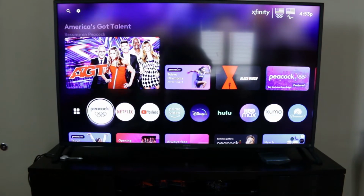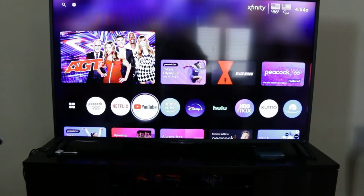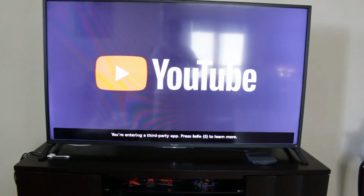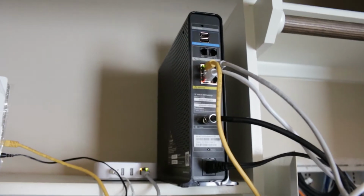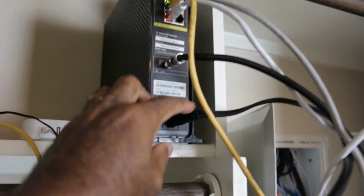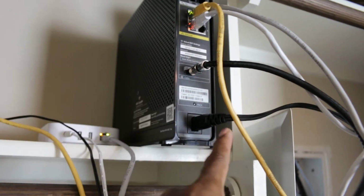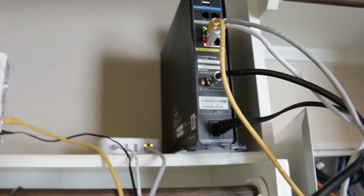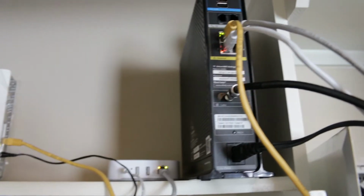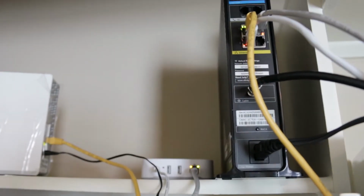First, I have to check whether it is a router issue. In my case, I know that my router is okay because other devices connected to it function well. When you have a router issue, you can simply reboot the router by unplugging the unit and replugging it from the electrical supply. Most of the time, this resolves the problem. If no success, you can call your internet provider and have them investigate. A possibility may be a service outage or a defective router that needs replacement.